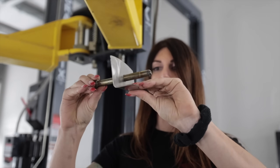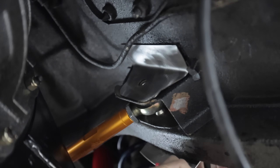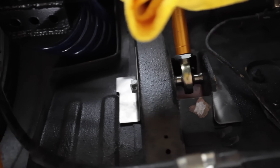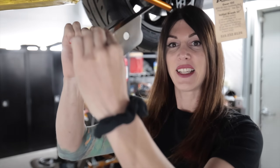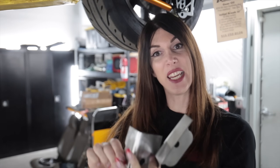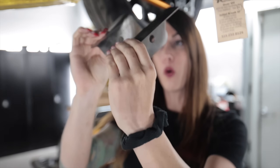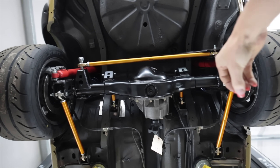It's got about half a millimeter of clearance — that's perfect. There is a tiny hole that's threaded right here for the parking brake cable. I'll just drill that out once these are finalized. Just throw a nut on there for now. If you're confused on the purpose of these plates, what these are going to do are basically sandwich the frame rail on the back of the car. These holes are what the upper link for the 4-link goes through, and that is going to bolt up to the underside of the car.